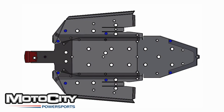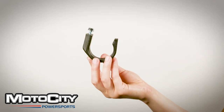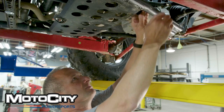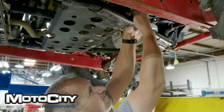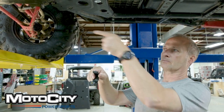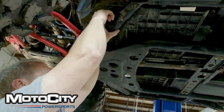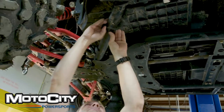Then do the same thing for the clamp areas shown in blue. Identify where they are and what type of clamp they'll need. If it's a clamp like this, you can attach it to the applicable plates. If it's a clamp like this, you can go ahead and put those over their designated tubing. Make sure the clamp's threading faces the correct way as shown in your installation manual. Warning: if you've ever driven your vehicle, ever, in your entire life, prepare for a light dusting when you do this.